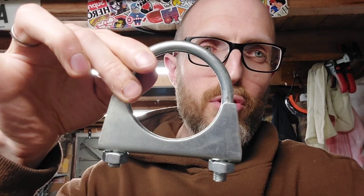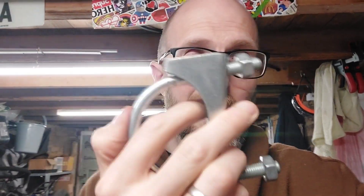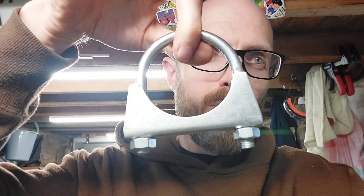You need something to physically bolt the anti-roll bar to the car. What we're using is these — 67mm exhaust U-bolt clamps. You need some heavy-duty ones; don't cheap out too much. This will go through the beam and then the actual anti-roll bar clamps will bolt onto this side. Once you tighten it all up, this tightens onto the beam and ties the clamp on there. You need two of these. Apart from that, you're going to need an anti-roll bar and brackets and bushes.